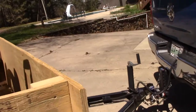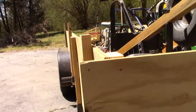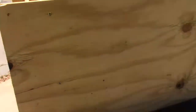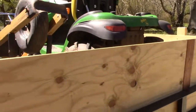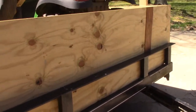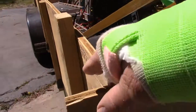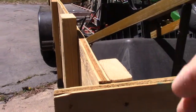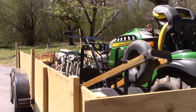Same thing here on the front. This piece of plywood is a little longer than my side panel there, and the only thing really holding that in is these screws here. I thought about drilling holes in my metal railing and putting it in there, but I really don't need to — that's enough to hold it. I made these a little bit longer. You'll notice it's longer than the trailer, but that's not a bad thing because I've got this fender sticking out back here — this is still skinnier than the widest part of my trailer. That way if I needed to, I could always attach another 2x4 or something and make it taller. So it gives me some flexibility. Anyway, that's my side skirt — that's my story and I'm sticking to it.